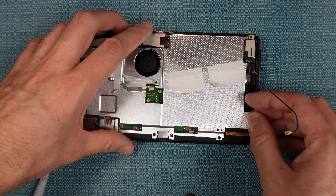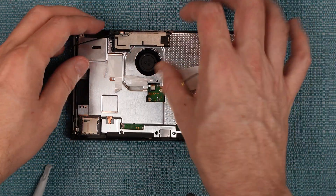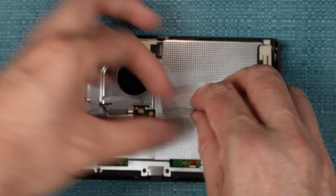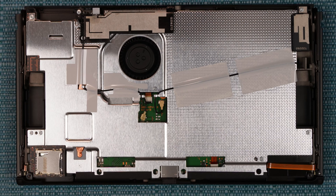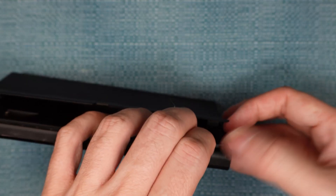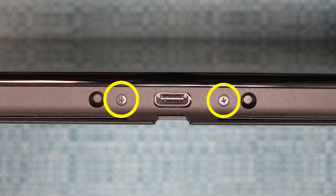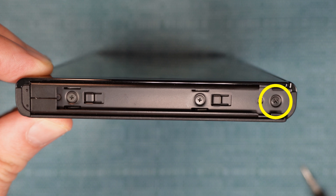Put the metal back on and put these screws back into it. Now put these wires back into place — it's hard to get them exactly like they were before you peeled the tape off, but here's the before picture, so use that as your guide. Snap the connectors for those wires into place. Place the back panel back on. Use your tri-wing screwdriver to put these two screws back into place, then put back these two screws which were on the bottom. There was one on the top as well, and then one more screw goes into each side.